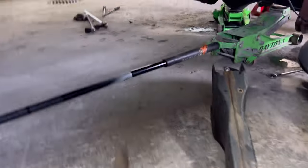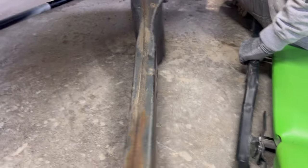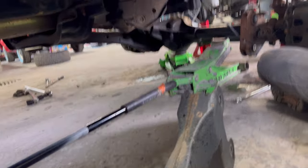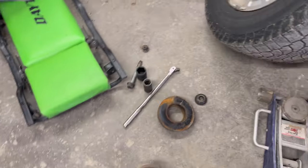Radius arm — 27 on the back, frame side; 24 millis on the front. So we got this guy off, we're putting the new one on. We're only doing one at a time, because if you do both, you're going to drop that axle down where the drive shaft is, so you don't want to get too throttled up.